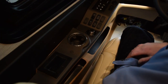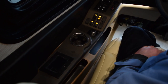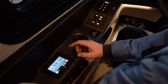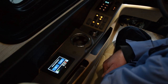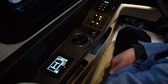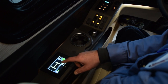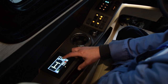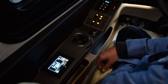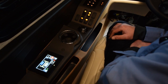Operating your leveling jacks via air or hydraulic — you're going to want to turn the key on and start the coach. Once the coach is running, it takes you to your home screen. To level, you want to go to leveling and select either air or jacks. We'll start off with the air. Press the air button — it comes up with eye-looking levels with little gauges in between that tell you if it's good or not. On this particular one, you can hit auto. You can either raise all or lower all. After hitting the auto button, it's all leveled.